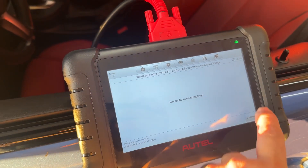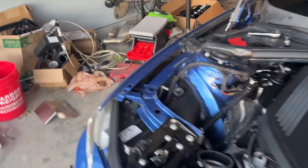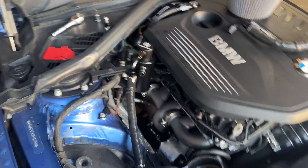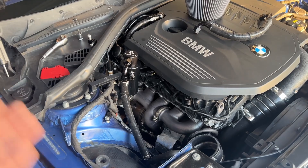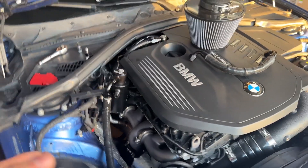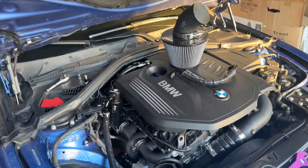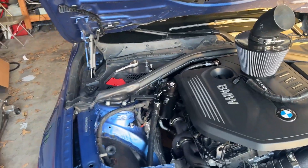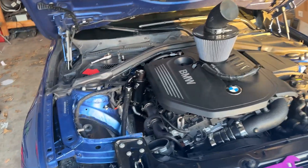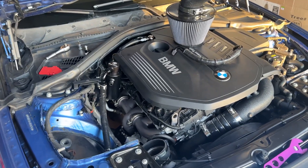When the test is completed, if you did everything correctly, you'll get: 'Wastegate linkage has been properly installed, no fault.' That means the wastegate is within spec — not too long, not too short. This is a pretty awesome tool to have if you're doing this, because otherwise you're kind of just guessing based on estimates like I showed in the install video. With the actual scan tool, you know for 100% that it's correct. I wish bootmod or MHD could do this, but that's the best way I've found.